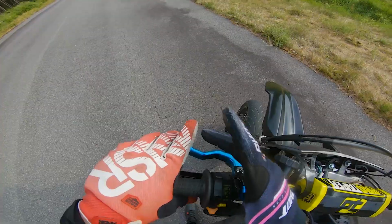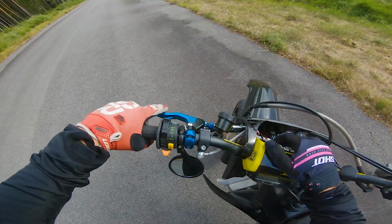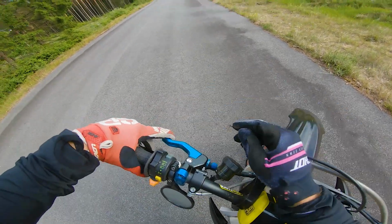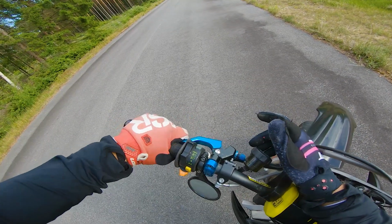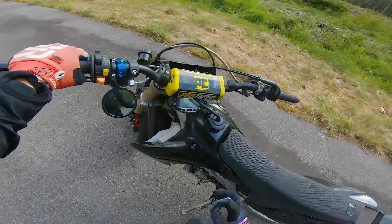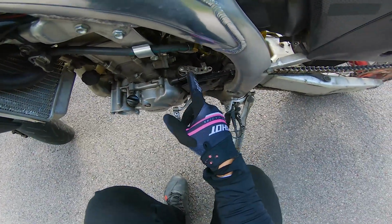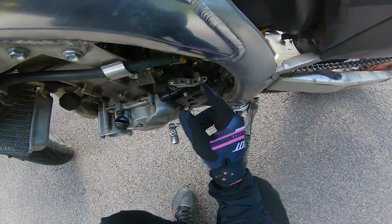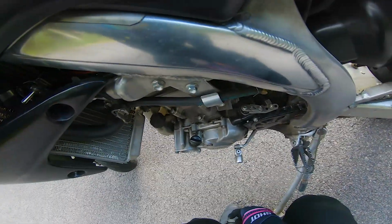So anyways, back to the clutch. When I started practicing clutch ups, I just kept pinching my ring finger, so that was almost one of the first mods I did to this bike. I got these also cheap China like RSC rip-off lever. It does the job, nothing wrong with it. It's a one-finger clutch and I like it. Which brings me to the next super important and almost like the best mod I've done to this bike, which is the lengthening of the clutch arm. So when I clutch, you get like that extra leverage. I'm not lying to you, this made the clutch pull like 30% easier.